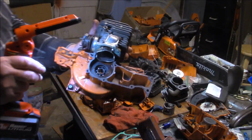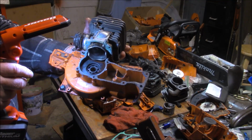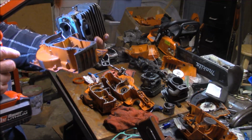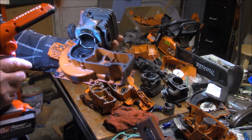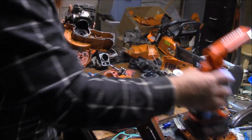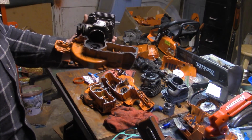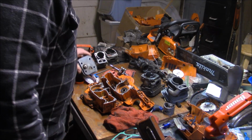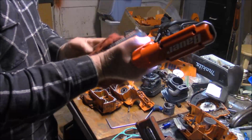You'll see how blacked it is down there. I mean, they got really hot. And this is one, yet again, that the PTO side had failed. And what my theory is now is if those nylons were running at a temperature they were designed to run, they're a little bit smoother and possibly a little bit less vibration, and they last just fine. That's not what killed them, is the design application.